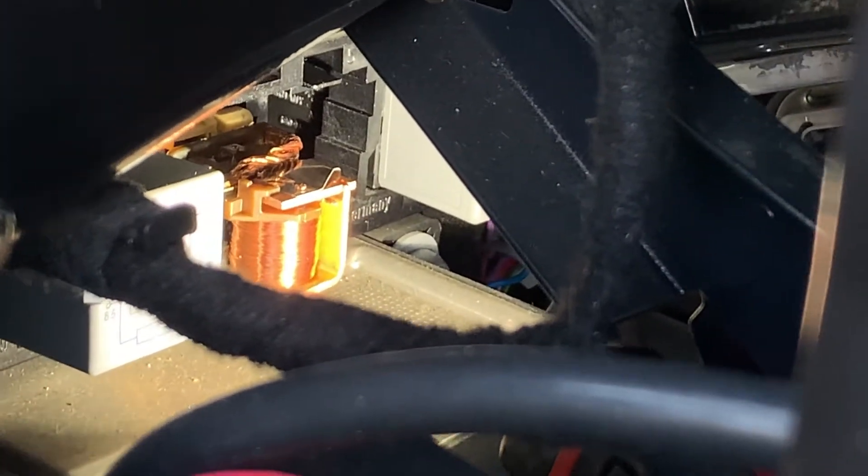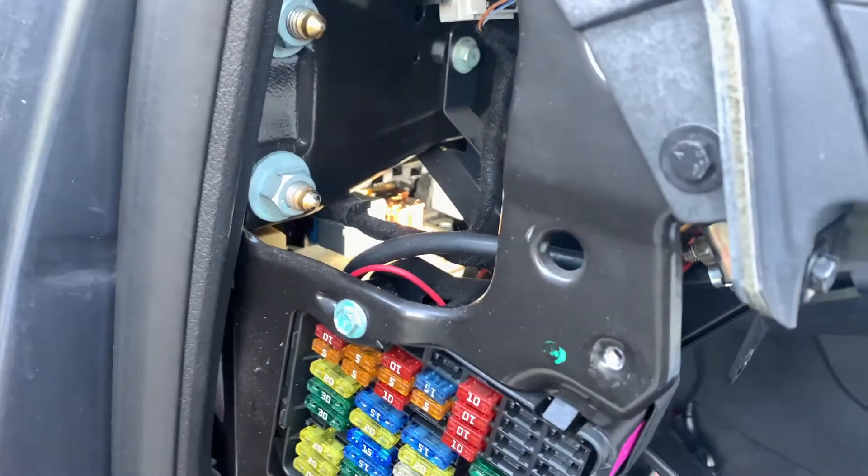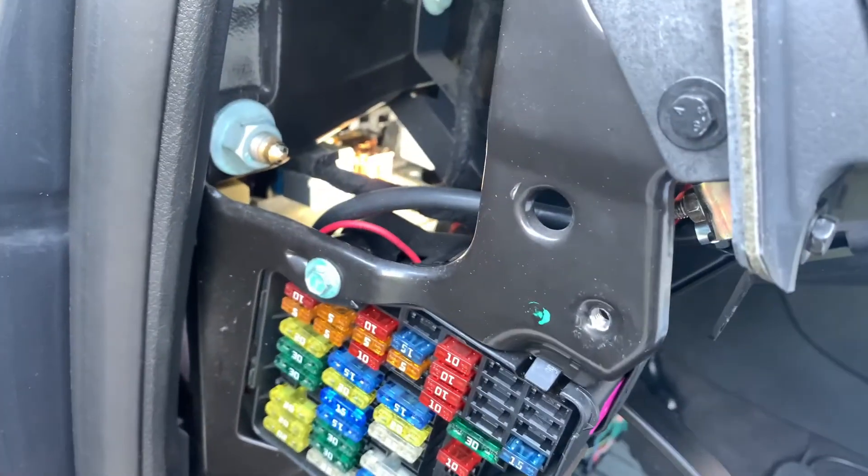Then it just turned off and I can do it again — push the brake with my hand, clicks on, clicks off. That's a good way to test a relay if you don't have a lot of tools.